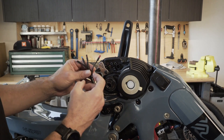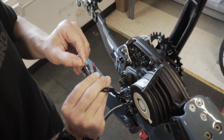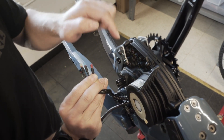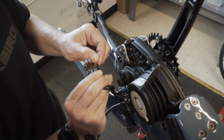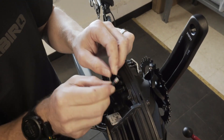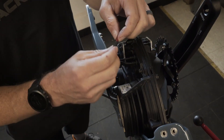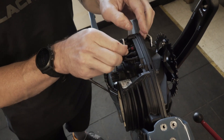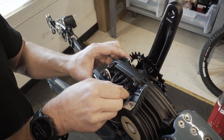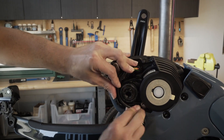To reconnect the wires, start with the small ones. Bosch wires have an indicator groove — white or otherwise — that should always be facing up on the bike. Connect the wires black first, then gray, then blue, and finally red. Then do the power wire, push it until it clicks, and tuck any excess cable back into the frame.